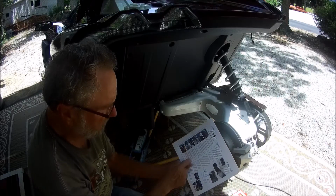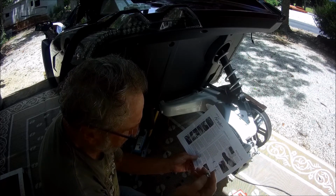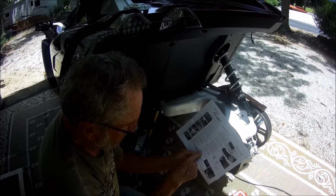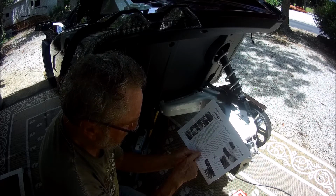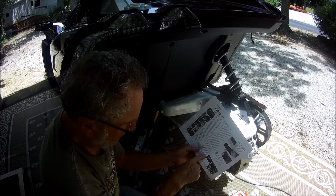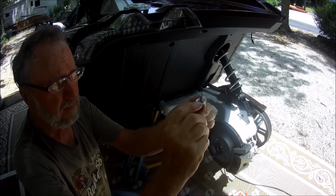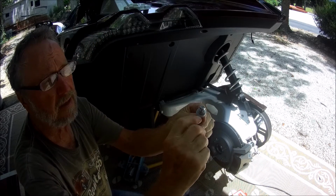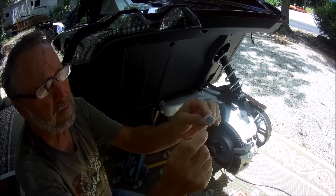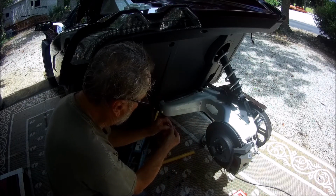So I'm going to do it all. We're up to step 15. Insert 3 6mm long screws with washers in place. Thread in only until the nut is completely engaged as shown in JK page 1. This is what it looks like: a lock washer, a stainless steel washer, and the plastic washer. The plastic washer is going to be toward the plastic material there, the sloping back panel.